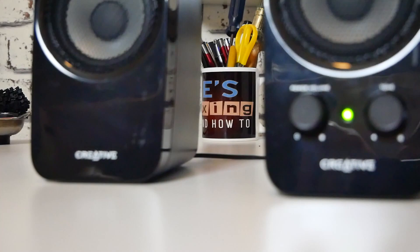Well they are desktop speakers, they are mains powered and you do get a mains brick included in the packaging. It looks like the plug slides out so you can replace it with the suitable unit for your particular region. This is UK, so we've got a three-pin plug on there and the voltage is 12 volts, 1500 milliamps. The cable is roughly about two meters long, so you don't have to be directly tethered to the wall socket.